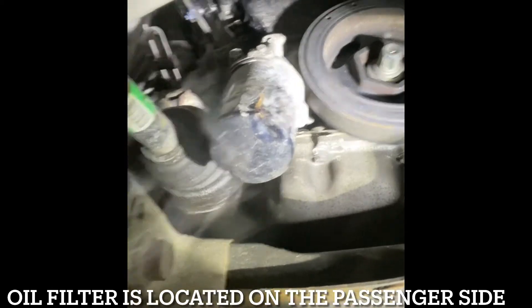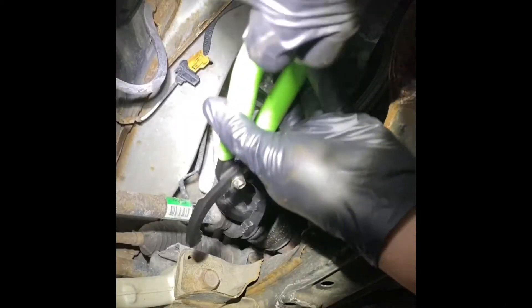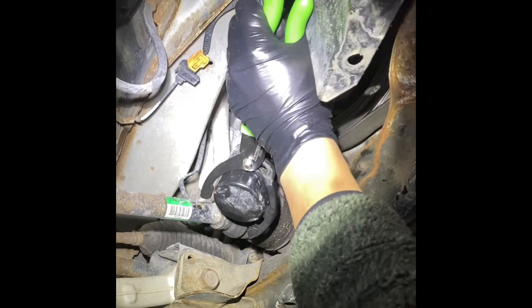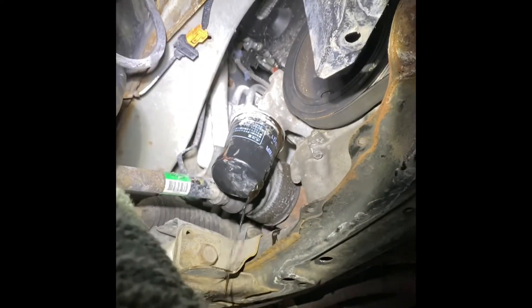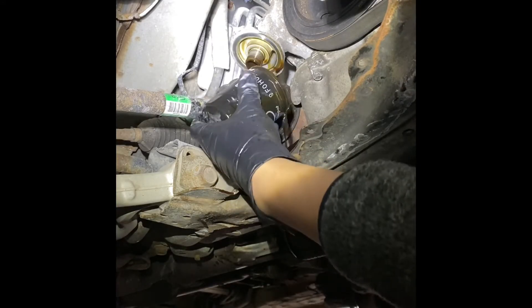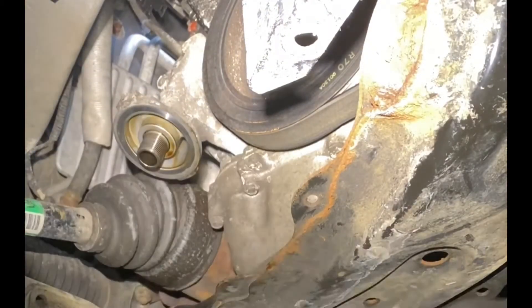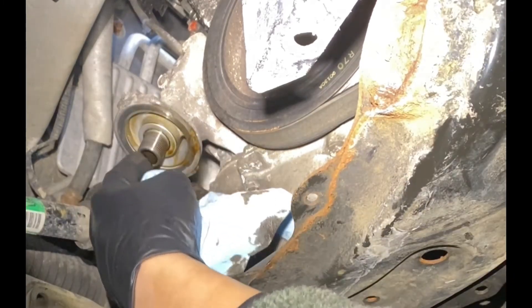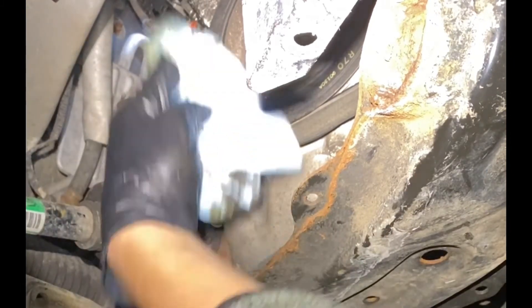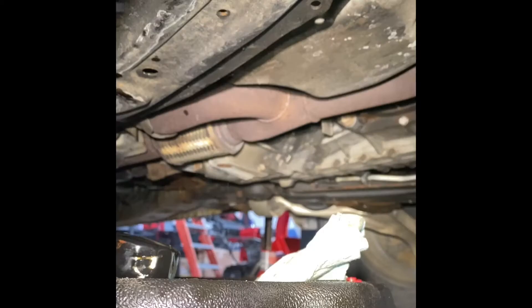That's the oil filter I need to remove and replace with the Bosch oil filter. I've got my oil filter tool — I already cracked it open but this filter is ridiculously tight. All right, it just cracked. At least I got it. I'll unscrew the oil filter now. Definitely clean the base where the seal sits — you don't want any debris affecting your seal and causing a leak. Wipe it nicely with a clean rag or shop towel, and that looks good.